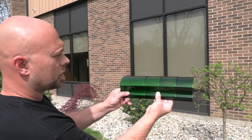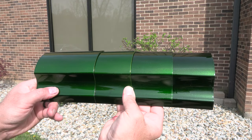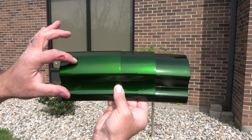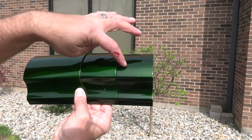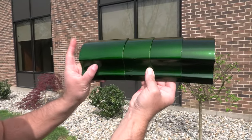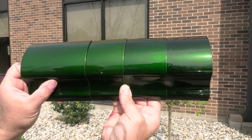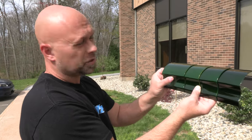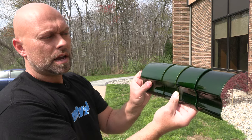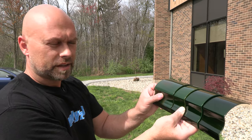Alright guys, we are out in front in the sun — managed to grab a little bit of sunlight. Outside in the sun, you really get the full effect of what the ground coat is doing with those base coats, those first coats that we put down. Starting from my left, this is the green over silver sealer, this is over gold, this is over the green sealer mix, and then this is over our charcoal metallic. The silver is going to be the lightest value. The gold has a little bit more of that warm kind of touch to it. The charcoal gives a dark. And the green is actually kind of nicely in between. If you're looking for something that's going to cover really fast — probably two coats of candy over that green — you're going to kind of eliminate the issue of maybe having a little bit of streakiness that would be inherent with spraying candy if you weren't super familiar. Color keying in this particular case is definitely the way to go, especially with a darker, richer candy. So I think that wraps it up for Color Mixing with Chris. I'm Chris Arpin, Createx Colors. Thanks for checking us out and we will see you guys next time.